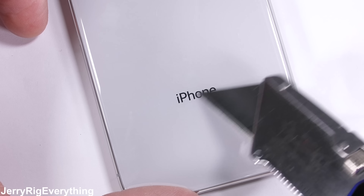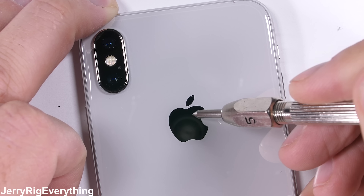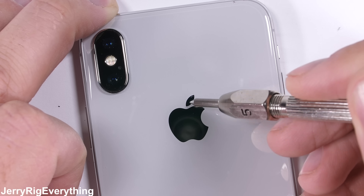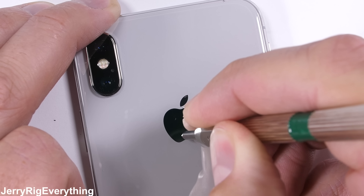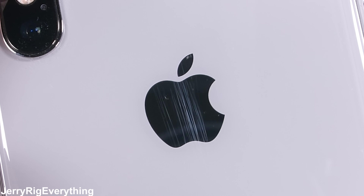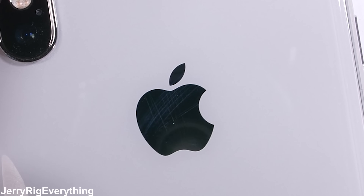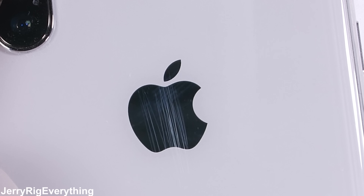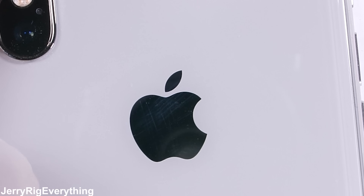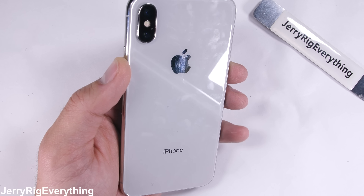The back of the phone is also covered in glass, and this is where things start to get bad for us as consumers. The scratch resistance is normal with no damage being done by my razor blade. The iPhone logo is underneath the glass, so it won't be rubbing off or get damaged. It looks like this was the same tempered glass used on the front of the phone, scratching at a level 6 on Mohs scale. So keys and coins won't do damage, but pocket sand and anything else over level 6 — like granite countertops or tile — will scratch the glass. So if you are the type of person who wants to keep your phone pristine, scratch and fingerprint free, one solution is a skin.